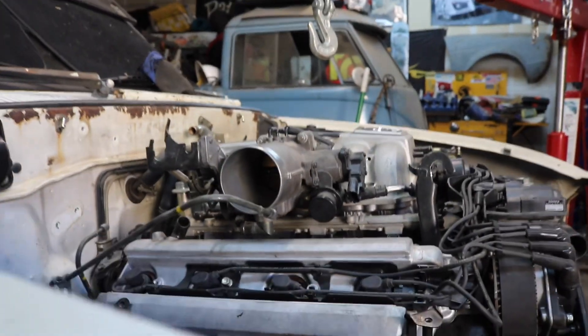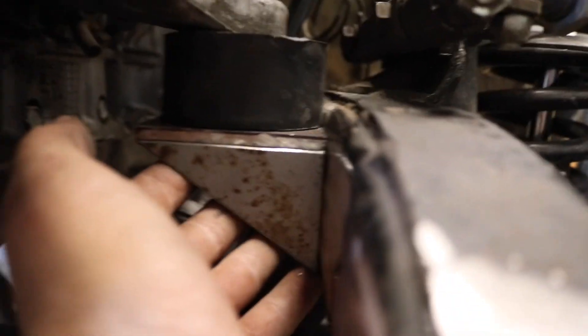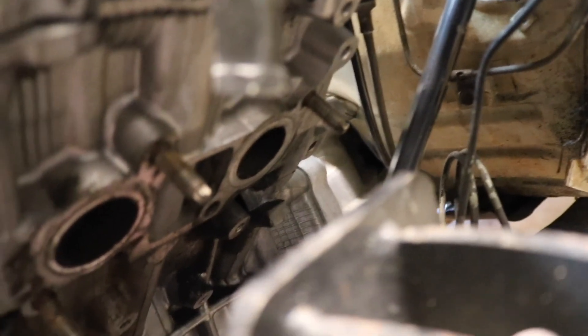Top plates are bolted in. Wanted to get another height check, so I bolted these fenders on roughly. It's hard to tell — I did mock up the hood on here, but the hood will clear. This is a little tall, but the hood's probably got about an inch or so of room. Let me show you guys inside — the transmission in here, the shifter, is pretty smack dab in the middle. This transmission came out of an '05 two-wheel drive Tacoma, so it's just a five-speed, R series — should be plenty strong enough for the 1UZ. With the stock engine mounts on here it looks like we only have to fab the bottom. I know I'm going to have some clearancing issues with the steering shaft and the header — I'm going to have to get creative. I think I'll be able to go around it, but we'll cross that bridge when we get there. I'm going to go ahead and try to tack these guys up and we'll see what's going on.